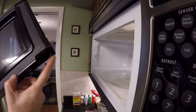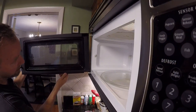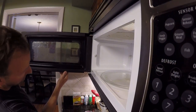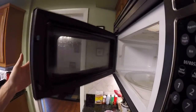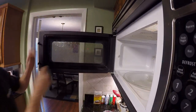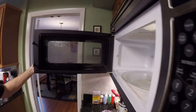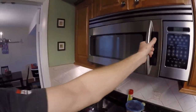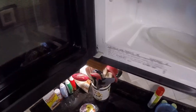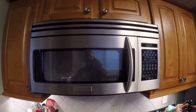We're going to set the microwave door down on the peg on the bottom — there's a peg in here too — so we go here, get this in the hinge, and drop it into the pegs. Heck yes, solid! Last thing to do: pop in your holder. Boom — the microwave is fixed! The rivets are totally awesome in there keeping that hinge super tight. There you have the Frigidaire microwave door fix; I don't have to buy a new microwave.